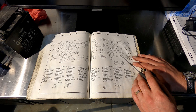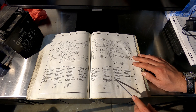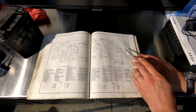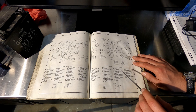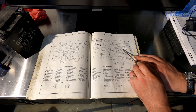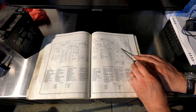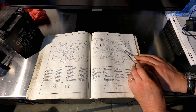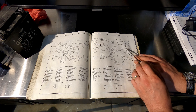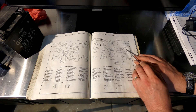We're having trouble with the temperature and the fuel gauges, so we want to look for those. Number 45 is the temp gauge and 47 is the fuel gauge. There's a color code — if you've got a black and white one, pay attention to those to identify wire colors. On the temperature gauge you'll have two wires: a light green with green stripe (LG/G) connecting both gauges, and a green wire with a blue stripe coming out the back. On the fuel gauge it's a green with a red stripe. Numbers 46 and 48 are the temperature transmitter and fuel tank unit — those are the sending units.